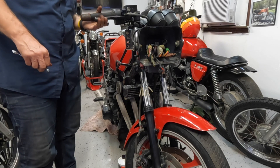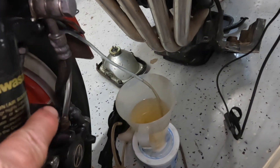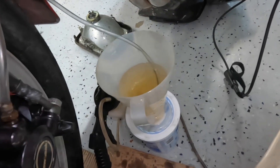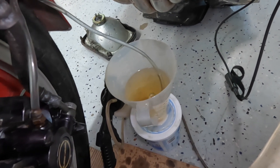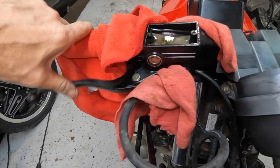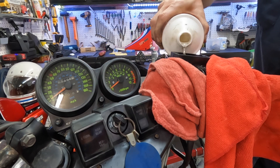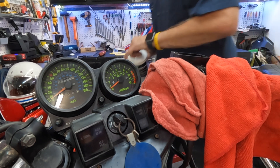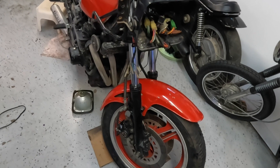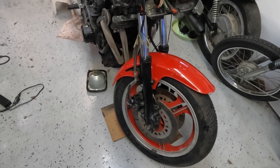Okay, now I'm going to see if I can bleed these brakes. I've got the bleeder line into the brake fluid and now we're pumping the air out. Keep an eye to make sure we don't run out of fluid up top. We'll do the left side, then repeat on the right — slow and steady wins the race. We have brakes, which is good. I'm going to cycle through it again because the master cylinder also feeds the anti-dive.